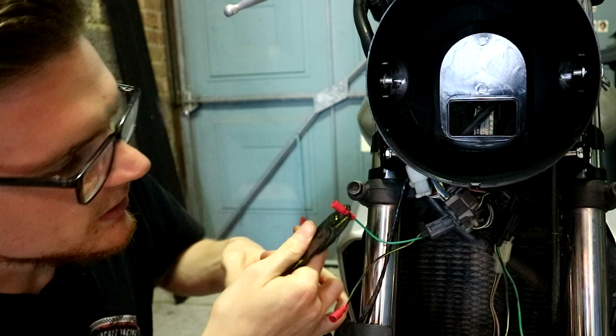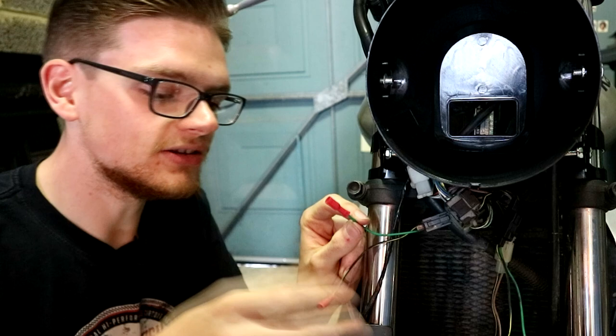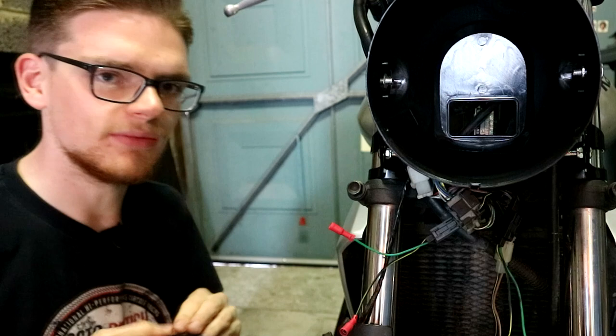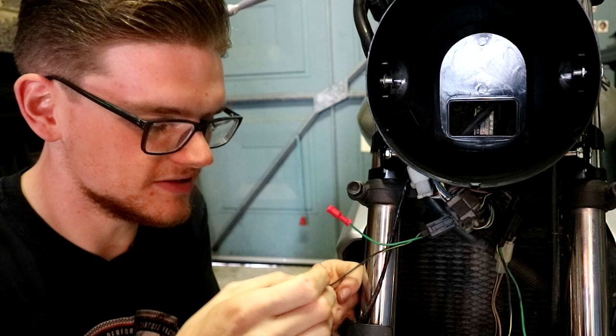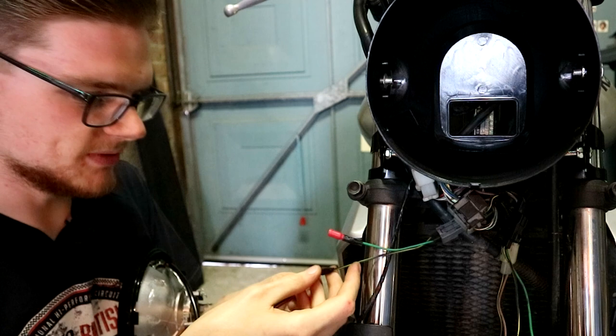Once you've done that, give the wire a little tug on the terminal to make sure that ain't coming out anytime soon, then do the same with the positive one. Once the connectors are crimped on and looking pretty solid, we want to make sure there's no liquid getting in there, so we use some electrical tape to seal it up — just enough to make sure disaster will be averted. Negative on the headlight is black, which connects to the black-and-yellow wire on the Kawasaki; meanwhile the green positive on the bike gets joined to the red headlight positive, with the ignition switched on to give it power.